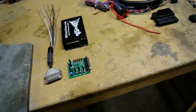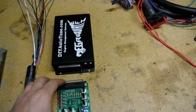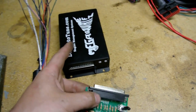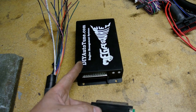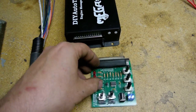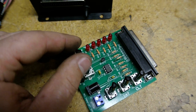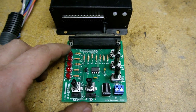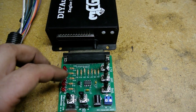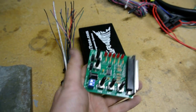This green board is called a stimulator. When you build MS1s — these all come pre-made, but the MS1 box you solder together yourself from a kit. When you plug the stimulator in, it simulates the sensors connected to a car: TPS, IAT, coolant, O2, and RPM. You can plug it in and watch the injector outputs on the ECU working while you input data. Turn the RPM up and down and the injectors flash faster and faster. You can bench test, load firmware, and confirm everything works.